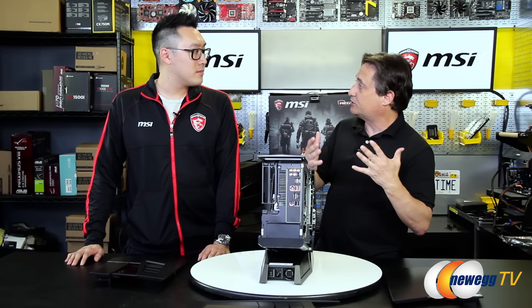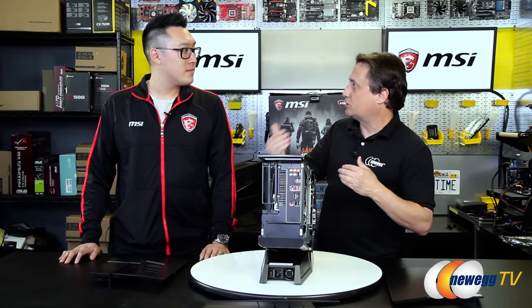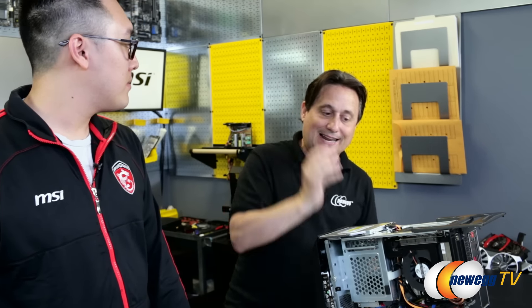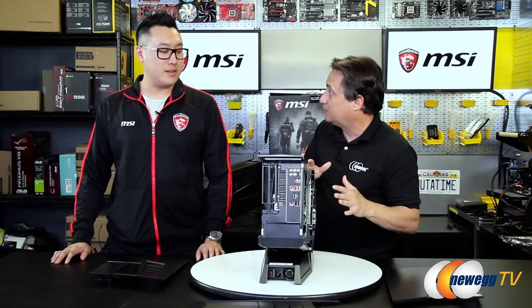It's interesting that DisplayPort and HDMI are there on a gaming machine. The modern Intel Skylake processors have built-in Intel graphics on the CPU. One of the benefits of buying a bare-bones system is maybe you can't afford the entire gaming system of your dreams yet — you could get this without any video card, with just your RAM, CPU, and hard drive, and be able to do some light gaming. Maybe that new video card's coming out next month and you want to wait. If you wait, by the way, you will wait forever — there's always another one coming out. But you can have the system today and get that video card later, because a high-end video card costs as much as this whole computer and then some.